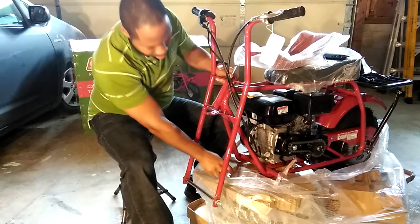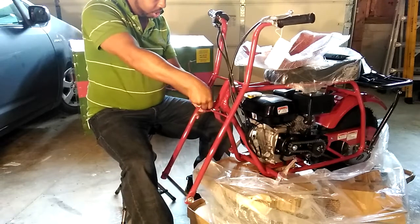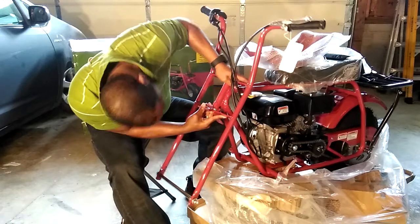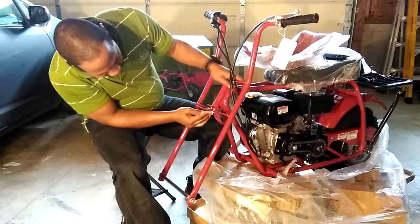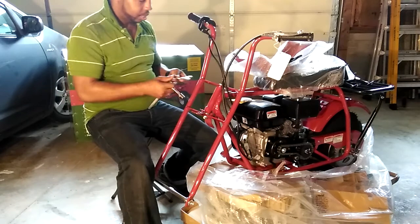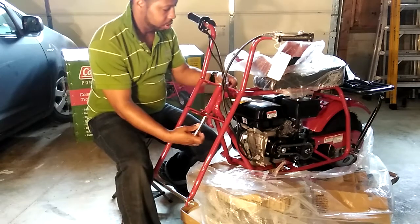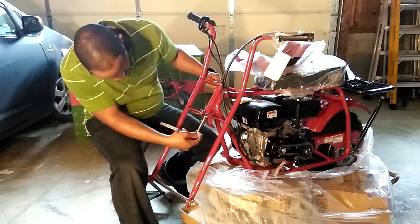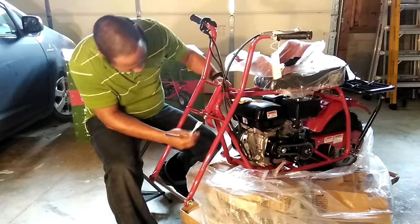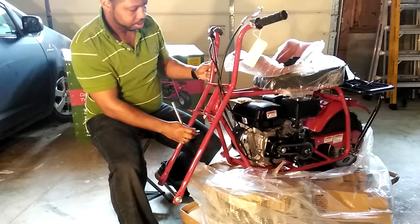That wasn't as bad as I thought. One of these is going to go on the other side of here before it hits in here, and I can get that through. Got it lined up. The other big washer goes underneath here, and then the nut goes on there. Got the wrenches — looks like this top one here is a 16, the bottom one's a 14. I'm going to use my ratchet for the bottom and just hold this top one in place. Keep checking — make sure you're not making it too tight. You don't want it loose, but you don't want it so tight that you can't turn. That should be good — we've still got good movement.